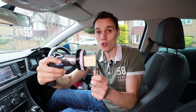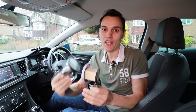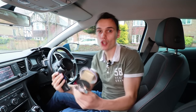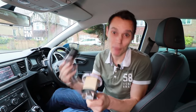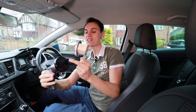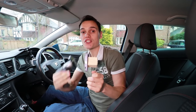The little bit of slippage between the two acts almost like a damper so that you can move away smoothly. If you try and get rid of that slippage entirely by lifting the clutch too quickly, you're going to get a big shock through the car and it's going to harm your transmission over time - it's like taking a hammer to your transmission. What most people believe, and it is true, is that when there's slippage between the two you are wearing the clutch, but the clutch is designed to deal with a certain amount of slippage so that you can move the car away smoothly.